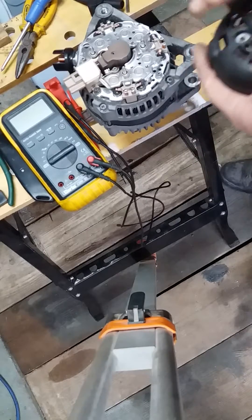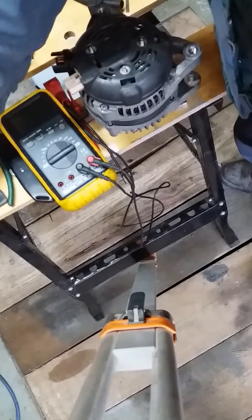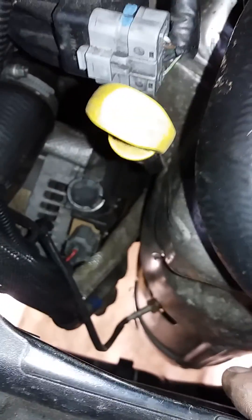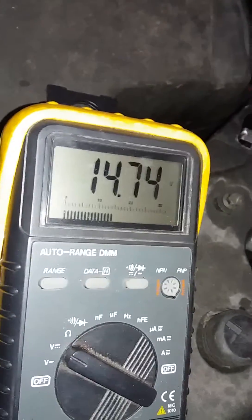We're all ready for the cap to go back on. We'll get it fitted back on the vehicle and then have a look at the end results. It's back in place, nice and neatly located. Just a point of interest on the V50: you have to slacken off the power steering pump from below in order to get space to remove and replace the alternator. So now we've got a nice charging voltage: 14.6, 14.7 with headlights on - a nice load on it - fabulous.